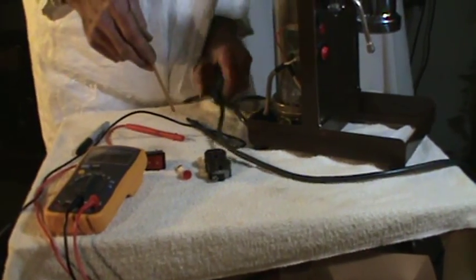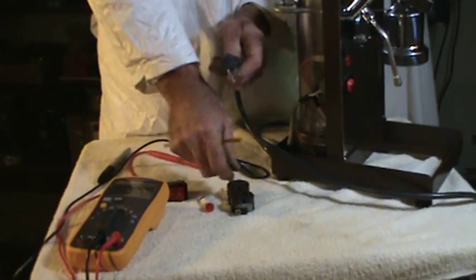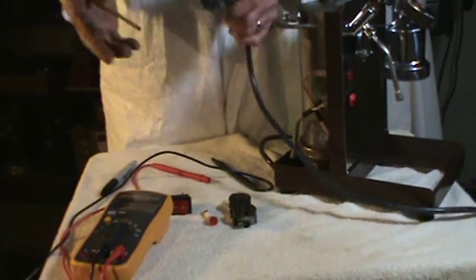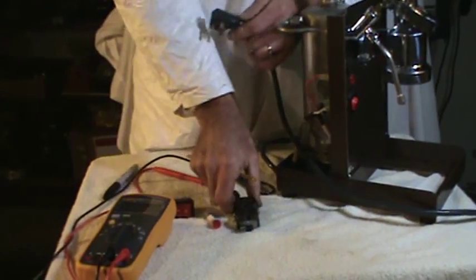The polarity is a safety factor — with a large spade on a plug, it will make contact with the neutral side first when you plug in the appliance. If it doesn't, that's when you see a spark or you actually get shocked.